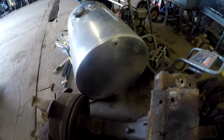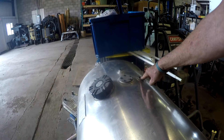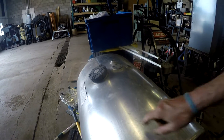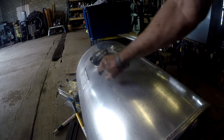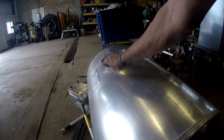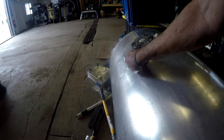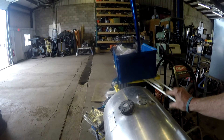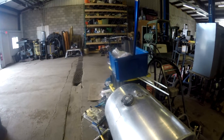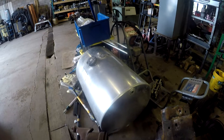Here is the other auxiliary fuel tank — the round aluminum one. The vent was fairly close to the top, but the fill spot is located slightly down on the radius of the tank, so you could never get fuel above that level. There was always an air gap at the top. I never had the vent issue on this one that I'm having with the current rectangular tank.